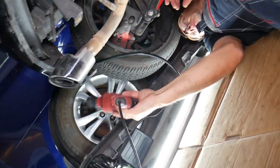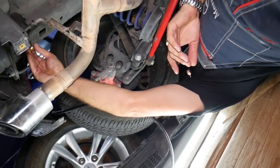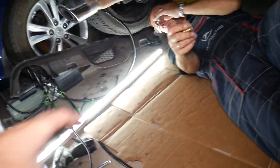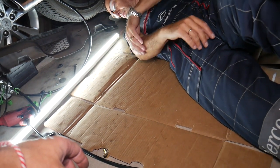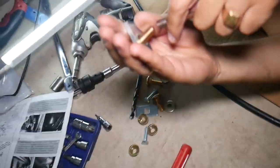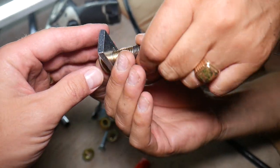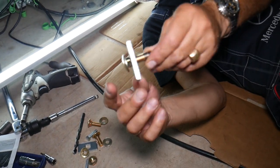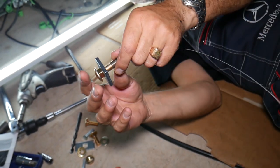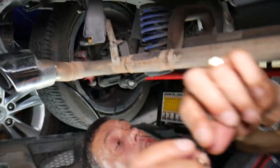We got through — now we'll make the hole a little bit bigger and see if the bolt can go through. The bolt needs to come in at an angle so we need the bigger 7/16 drill bit — that's why the 3/8 won't work. The bolt went in — perfect. Now we need to sweep everything here because we have metal shavings that can get stuck in your skin or eyes, so always be careful. We need to get a bolt and a rectangular piece, and we're going to screw it to a spring for fishing.